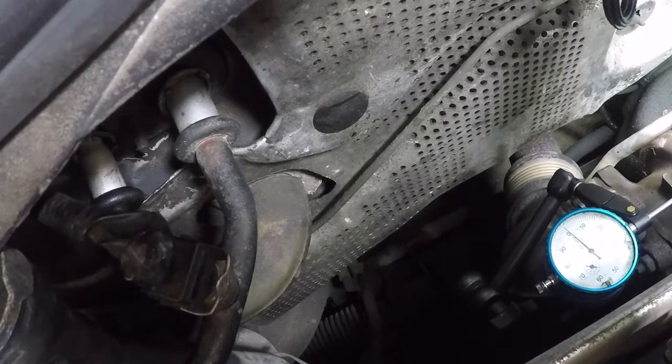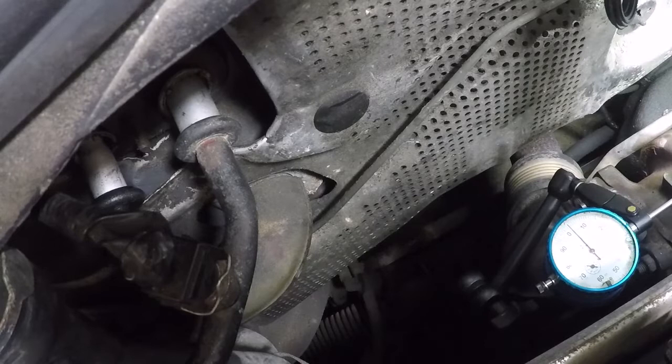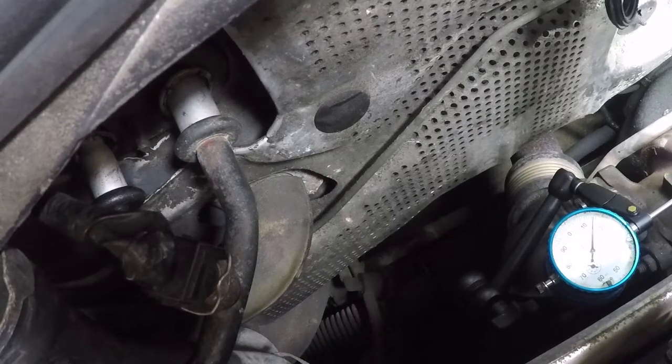I'm going to apply very slowly just a little bit of pressure. It's already moving — we are basically not even one PSI at that point. It's just starting to crack. Let's split the difference and go up about one and a half PSI. Okay, it's already open. We have moved 15 thousandths at the spot that I'm measuring. It's off its seat — not by a ton, but it's off. It shouldn't really be doing that at this juncture. At one and a half, two PSI, it shouldn't be dumping any of that pressure.